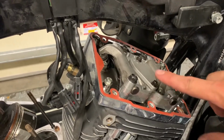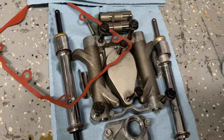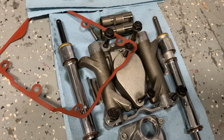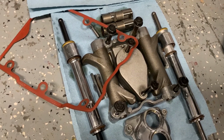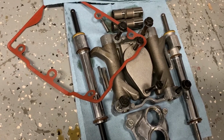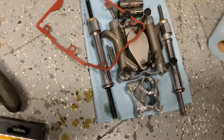Then it's these 4 bolts that hold the rocker assembly on. You can see what the rocker assembly looks like over there. I find this pretty interesting personally, just because I'm used to standard pushrod engines that don't have rockers shaped like this. The rockers are normally just pivoting on a part front to back. Here you kind of got the shaft pivoting as well.